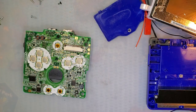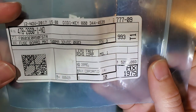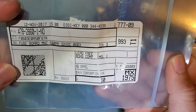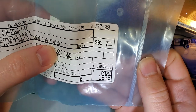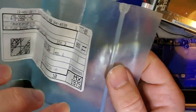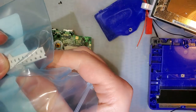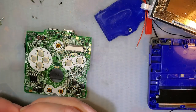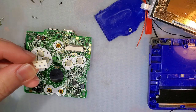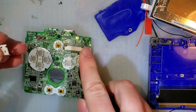So let me go ahead and boot up my soldering iron. And while that's loading, let me find the fuse that I have. So because of who I am as a person, I already have these just laying around. These are 500 milliamp, 32 volt 0603 fuses, and I'll throw a link to these down in the description. These are not exactly the right spec, but in this case, it'll work perfectly fine. I'm gonna go ahead and pop one of these off here.